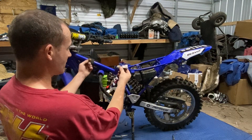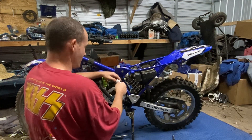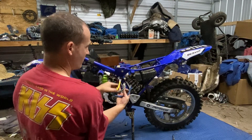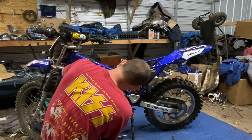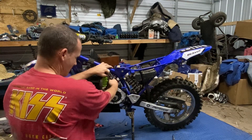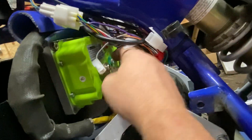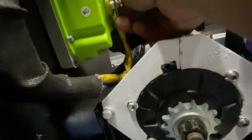For those that don't know — this comes off the motor, it's a hall sensor wire. If you don't have it plugged in and it's not turned off in the controller settings, your motor will not spin at all. So you want to make sure that's plugged in. And then these are your three phase wires here that go down to the controller unit. Right now I'm hooking these three phase wires to the motor.